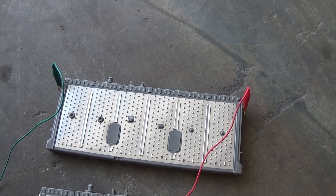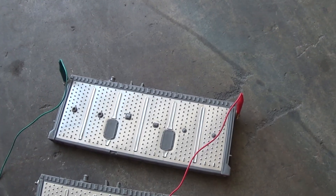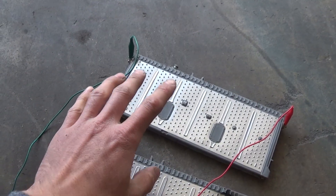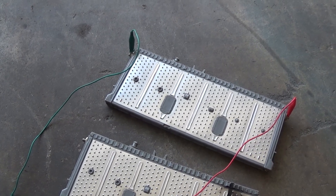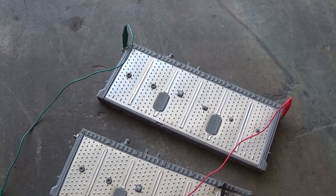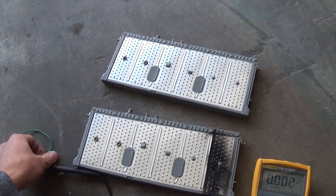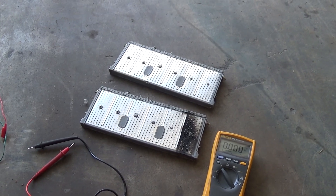The second bad module was about three-quarters down the pack. I couldn't tell you exactly why it only measured 6.35 volts, but I replaced both of these, and then also went ahead and replaced the next two lowest modules which were at about 7.5 volts, swapping them for modules at 7.6 to 7.7 volts. The whole battery pack is nice and happy now — everything's working great.